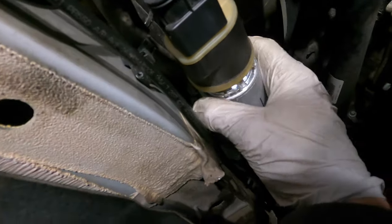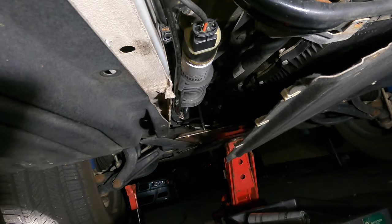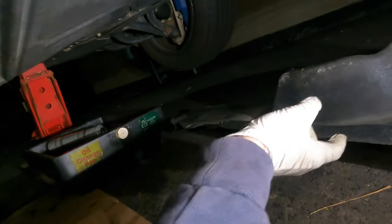After the car has been running for a couple minutes, check for any possible leaks, which there shouldn't be any. Once there aren't any, just put the cover back on and you're done. That's how easy it is to change your diesel fuel filter on the X5. Don't stress about priming the system after you replace the filter — as you saw, the startup only takes about two to three seconds. The procedure was mainly designed in case the car cranks for a long time to save the high pressure fuel pump, but it's really not needed nine out of ten times.